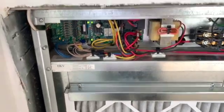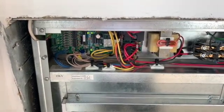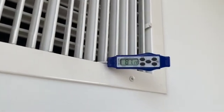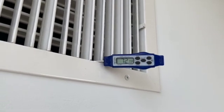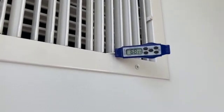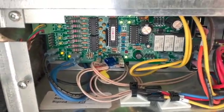There is a five-minute compressor delay on startup. There's our compressor now. Let's go ahead and check the discharge temperature to see if we are in fact starting to cool. All right, that temperature is dropping nicely. So the only thing that was cutting this machine out on the low refrigerant temperature was just the fact that the sensor was disconnected from the board itself.